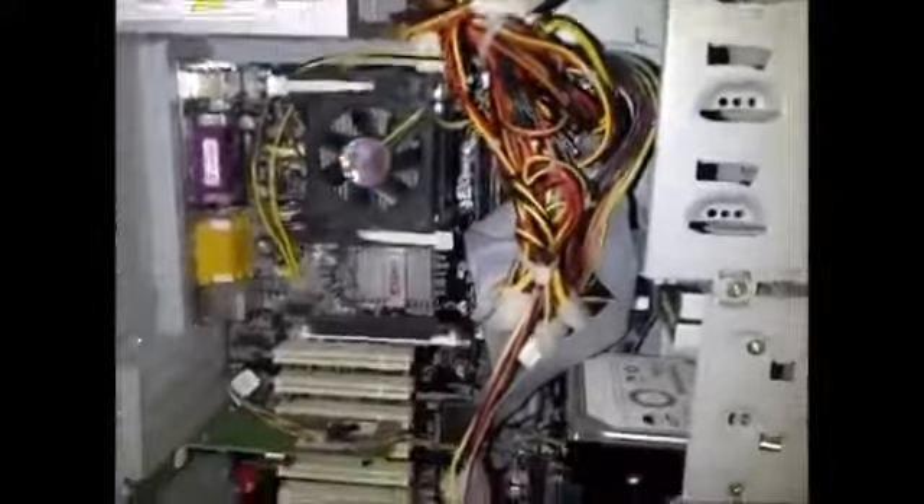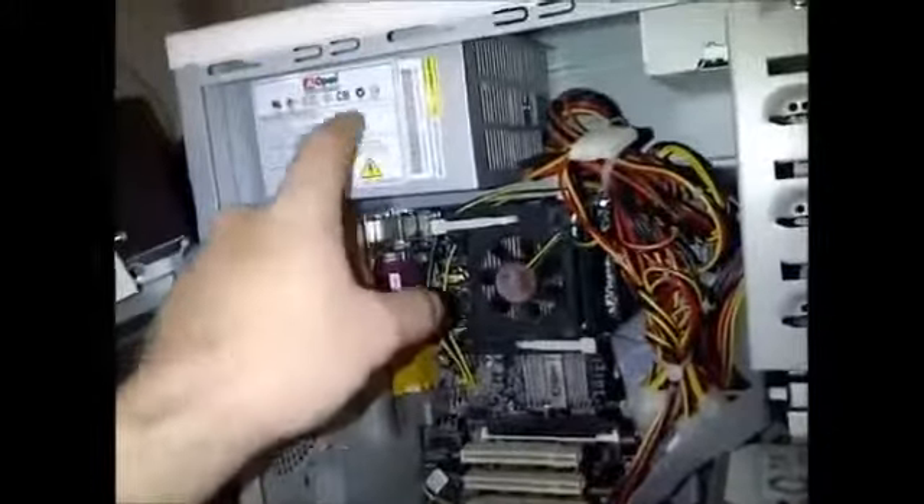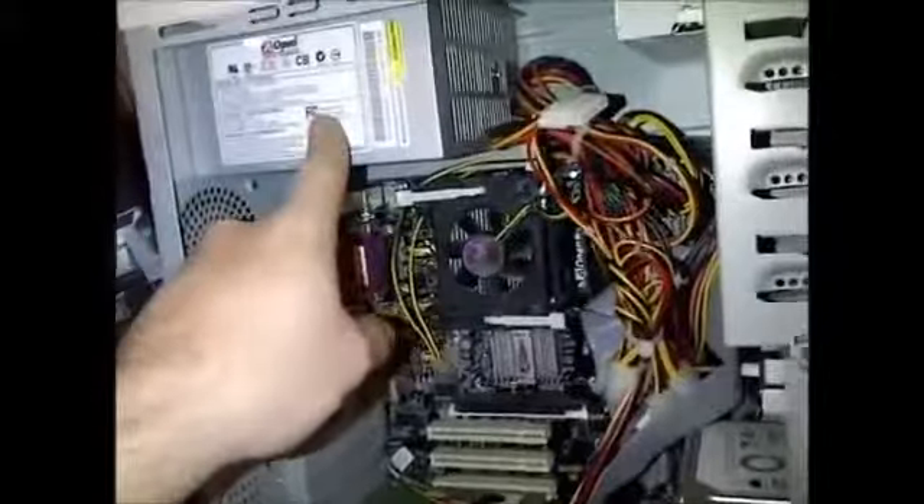If you do not have at bare minimum a little jump — a tiny bit of movement — and the little indicator lights at the bottom of your motherboard near the bottom of the case turn on when you put power to it, good odds it's the power supply. These things fail a lot.